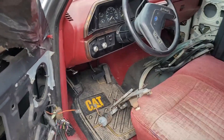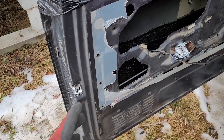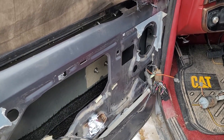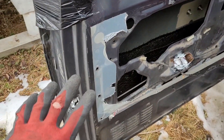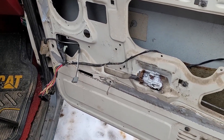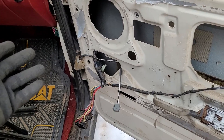Here's where I'm at right now. I'm going to order the window motors. I put some garbage bags on the doors to cover them up for now. As for the door lock solenoids, I'm not even going to bother buying them — they're really expensive for something I don't strictly need. I did go ahead and grease everything heavily to make sure it was all good, and Loctited all the bolts. Both doors are now identical. The one extra thing on the passenger side was that the wire harness wasn't hooked up, so I passed it through and made all the connections again.